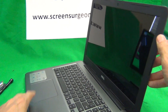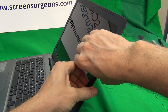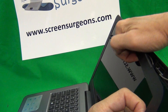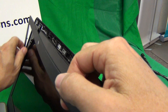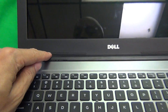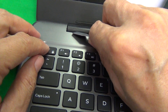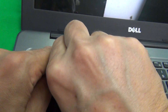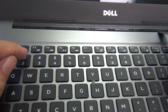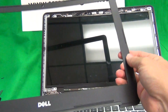The first thing you want to do is snap off the screen bezel — that's the plastic frame around the screen. This one doesn't have any screws, so just put your fingertips or fingernails on the screen side and work your way around. It might be a little harder if it's the first time it's coming off. On the bottom there is a seam that needs to be opened up using the spudger tool. Insert the spudger into the seam and gently work your way through to snap it open, being careful not to damage anything. Once the seam is opened you can snap the bezel off.